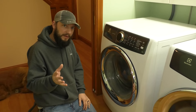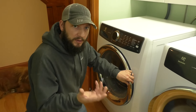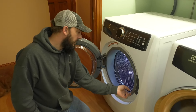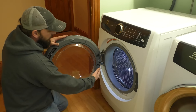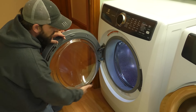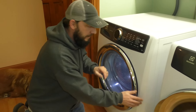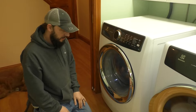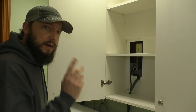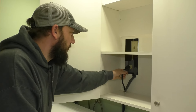Something else that's happening is this is leaking from the front — buildup of soap and residue around here can cause that, and around the door right here. So while I'm cleaning all that, I'm also going to clean the door area and hope that fixes the problem. So let's get gloved up, put some cardboard down here, and start cleaning. Before I start, I'm just going to unplug this because there is a light in the door seal.